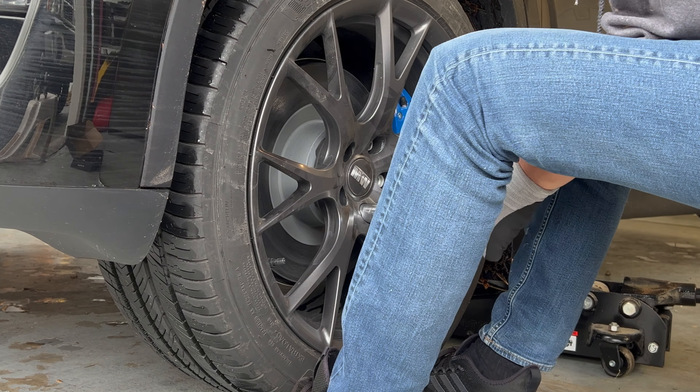Martian Wheels suggested the Bonus brand, and since I trusted Martian Wheels I trusted the brand of spacers that they suggested. Here I'm just pulling the plastic caps off — that was an option Martian gave you, to put these little black plastic caps to cover them. Super easy to just pull these off. 21 millimeter for the lugs — the stock lugs.